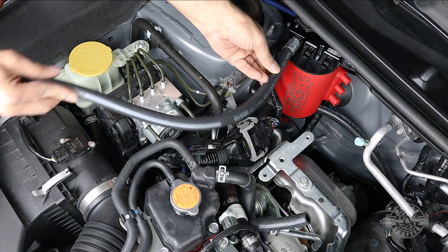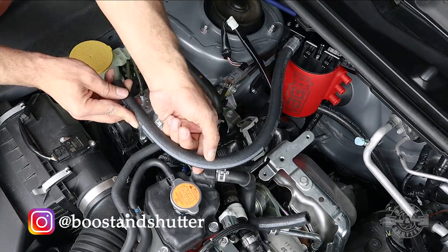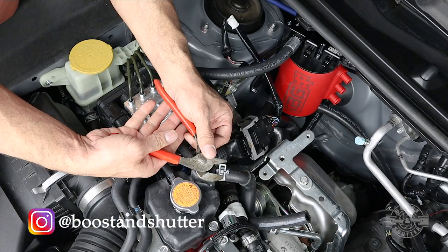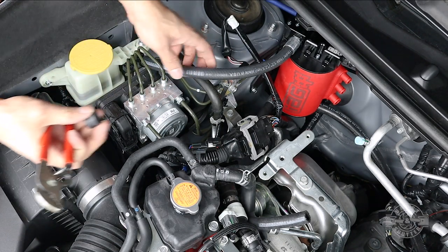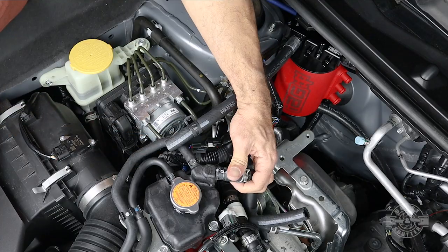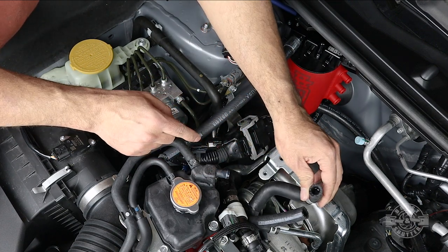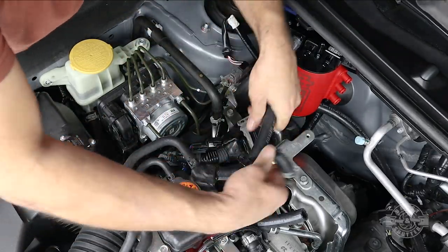For the top coolant line, bend it a little since it's going upward — you can't have too much hose or it'll fall on top of the intercooler. Mark the hose after you measure it and use hose cutters to cut at that spot. Slide the pinch clamp off the barb of the top coolant expansion tank hose, then slide the included pinch clamp over the new top coolant hose. Slide the original hose off — it will have some coolant in it — then push the AOS line all the way onto the barb.